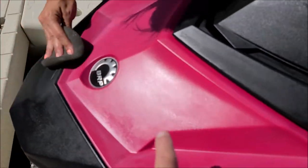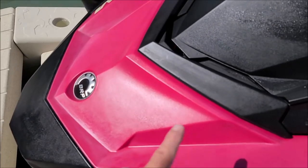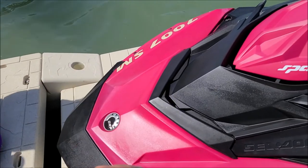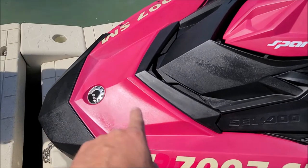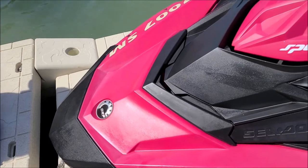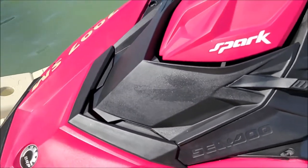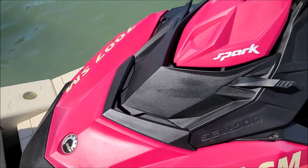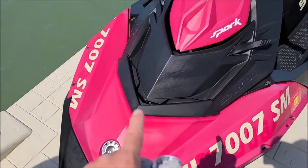You want to keep working it until you see the high spots. When it sits on there and you can see all those high spots, we're going to wipe those down and make it even. Those high spots mean the product — which has a penetrant in it — has soaked into the plastic all the way through, and you're building it out. When it's not penetrating anymore and you see all these high spots, that means the plastic is properly hydrated. Let that soak in for about 10 to 15 minutes in the sun.